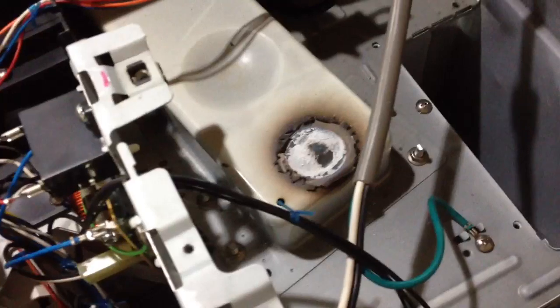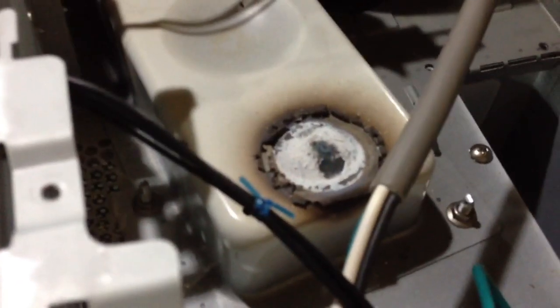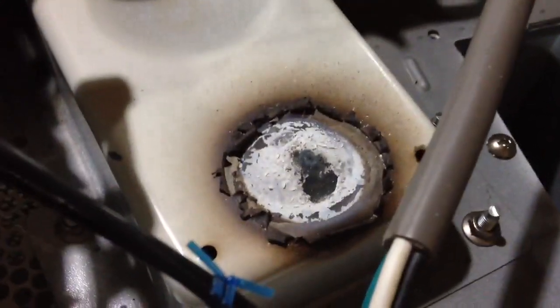Here's the problem. Unplug it, take the cover off, and you need a new magnetron. You can see it has obviously got issues. Underneath this cover is the part that does all the actual microwaving. If you take that off, it's a little box with a piece of metal sticking out, and you can replace those. Then the whole thing will be up and working again.